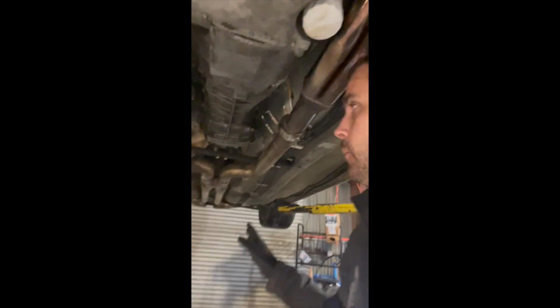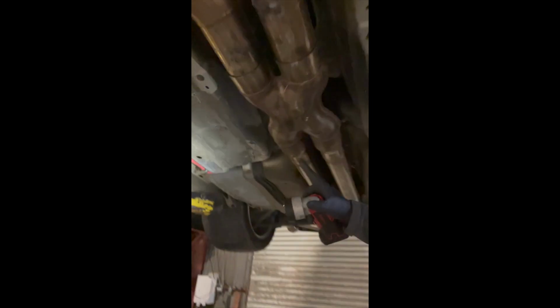Another thing is this is the exhaust. I'm going to work on trying to replicate this exhaust system so that y'all don't have to go to an exhaust shop. That may or may not be an option that y'all are wanting to do. I think it would definitely simplify things. So how this works is right now I'm using a 3-inch to an X pipe, and then from the X pipe I go down to a 2.5, and then I go around the differential, and whatever option y'all want, y'all can put whatever muffler you want.